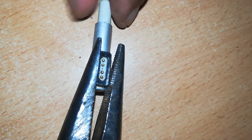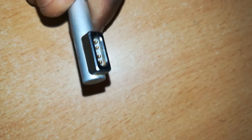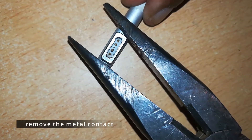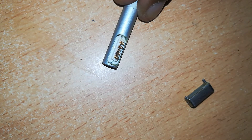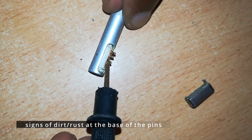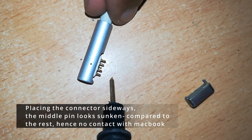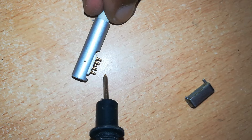After cleaning, if the pin is still stuck, as you can see in this case, we can go ahead and remove the metallic contact part to have better access. Any pair of pliers will do — use them to pull off the magnetic contact point, that is the metallic contact point. If you look really closely, you'll see some rust or dirt, and a close-up view shows us clearly what is happening: the pin is definitely lower than the rest, so it's not touching the contacts on the MacBook side.